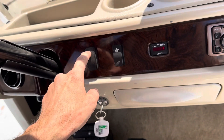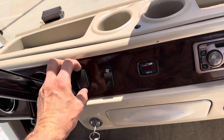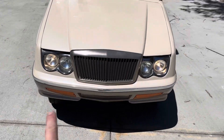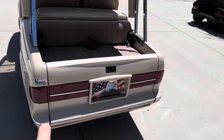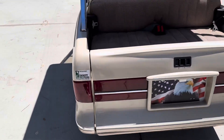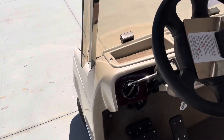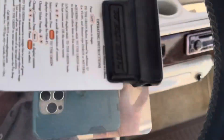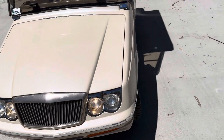Right here you've got your headlight and tail light switch. There are two settings — right here I'll show you what I mean. Up, you have your two outer lights, and in both cases you've got your rear tail lights as well. All the way down you have your inner high and low beam setting.